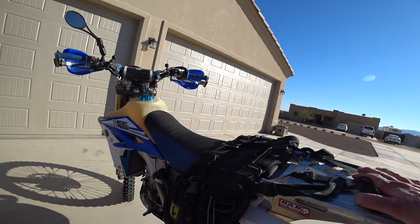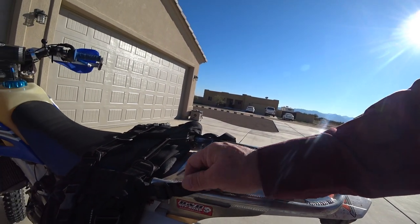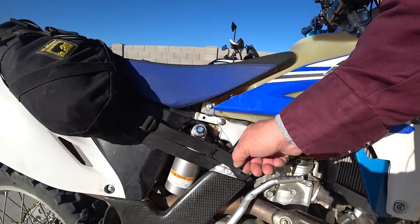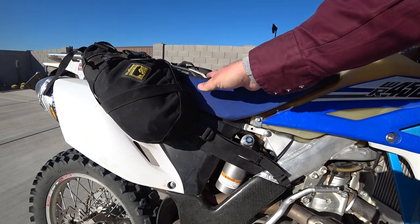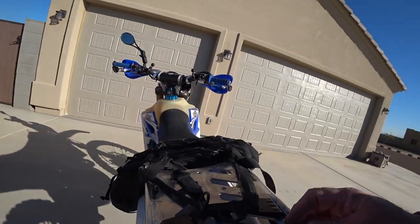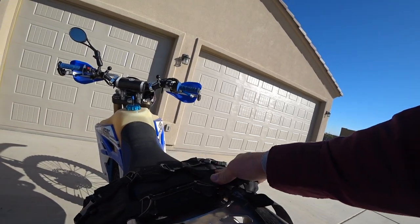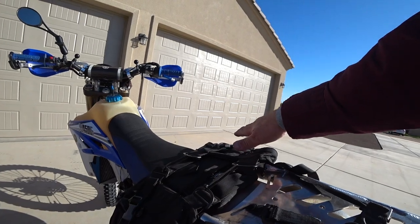As far as the mounting process: I throw the bags over the seat and then loosely position these two straps without cinching them yet. Then I go around, get both of the front straps cinched up pretty well, and make sure the bags are exactly where I want them — riding behind me on the bike, not interfering with my leg or movement. Get these lined up to the length you want. Once both front ones are set, pull the rear straps tight, make sure they're centered, and keep pulling back until it's nice and tight with a good straight line of pressure on the bags.